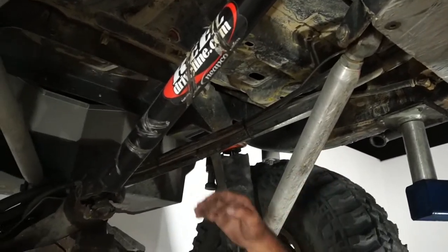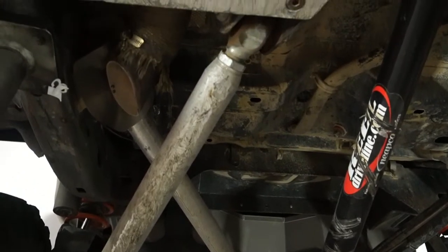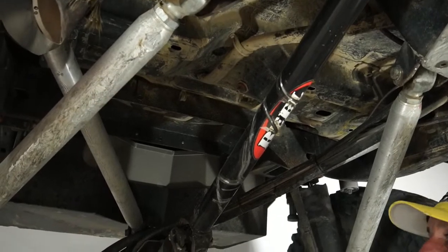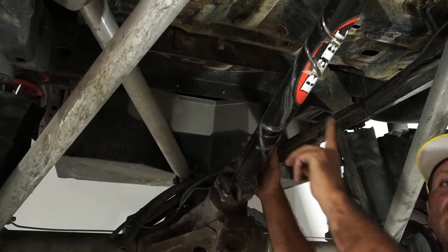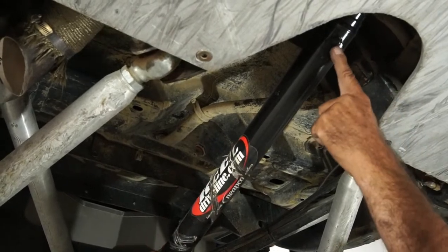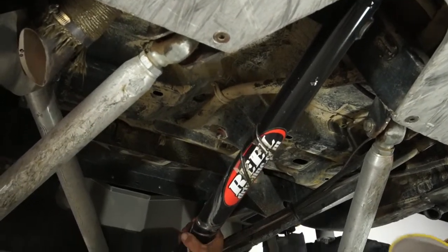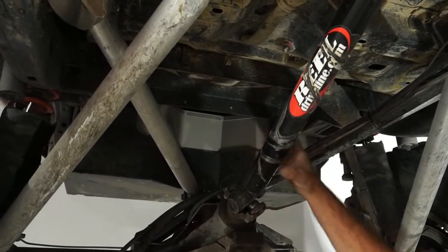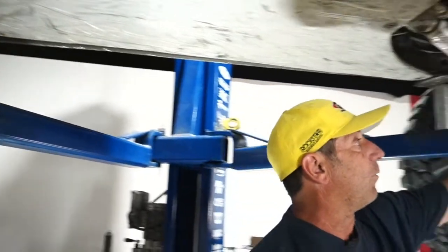The limit strap also helps protect the shocks from getting yanked — I've seen the top of a shock pulled out. You can see all the hoses, wires, and brake lines run down the upper control arm, out of harm's way. A lot of this stuff got pretty scraped — the Hammer trails are definitely no joke. Jim J-Real builds me a heck of a drive shaft I can beat the daylights out of. My slip is not at the bottom — never put it there. It's hidden up here, and even my balance weight is up here so you can't hit it. I'm running 1350 U-joints on both front and rear.